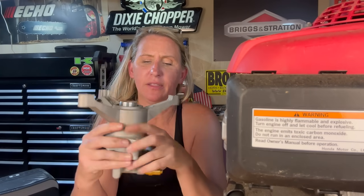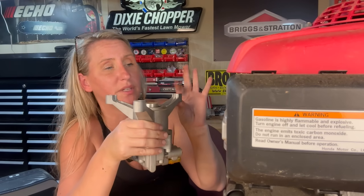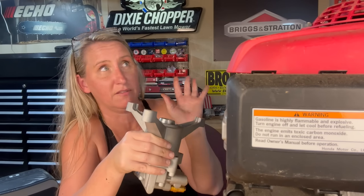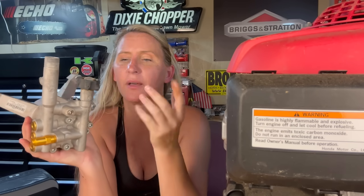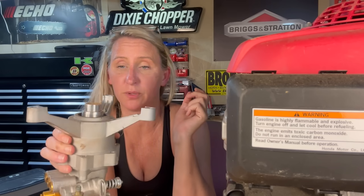I did not buy a brand new pump to put on this machine because I'm going to wait for one to come in with a bad engine and a good pump and make two out of one like I always do. But if you do order one, some of them will look slightly different — some of the aftermarket ones. You'll need to make sure that if you have an aftermarket one, if there are any spacers, be mindful of whether it actually mounts up flush. Because sometimes you will need spacers — if you go to tighten it down and you're tightening one, the other one will break off on you. Believe me. Also, there might be slight variations: sometimes the water connection will be longer. That's okay, that's not a big deal. You just want to make sure it is going to mount correctly. If it has a spacer inside, make sure you put the spacer back.